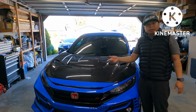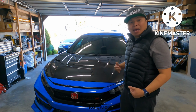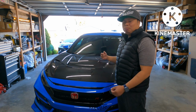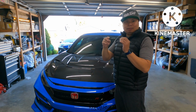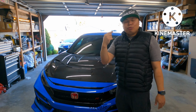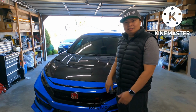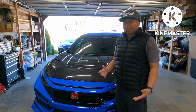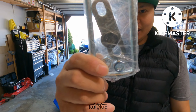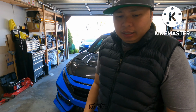And my issue here, I messed up the latch. It's my mistake, my bad. This is my first carbon fiber hood, and I never took off the plate. I don't know why. I put the bolts, and they have two bolts that make a sandwich. I never noticed the fiberglass doesn't have room for the nuts. Then I tightened it until the thread was not good. Then I was looking for a replacement bracket, and this big one with the longer thread is the only one I saw on Amazon. And